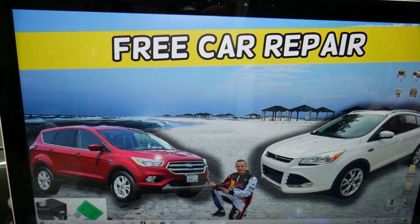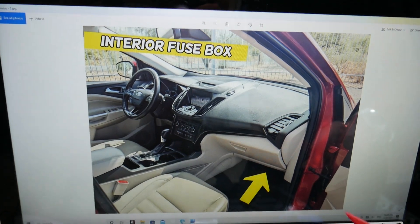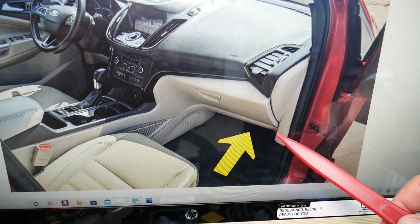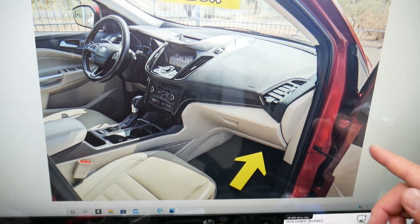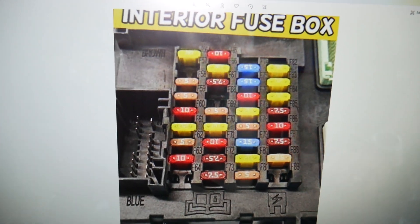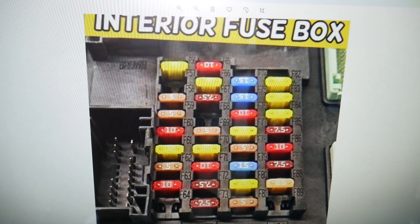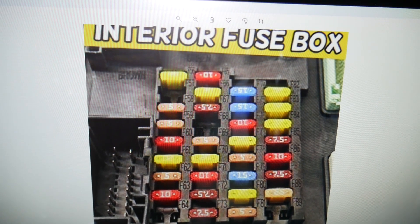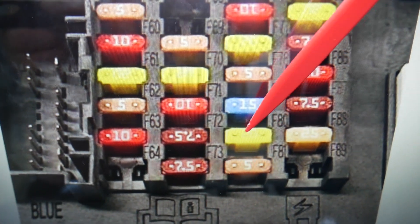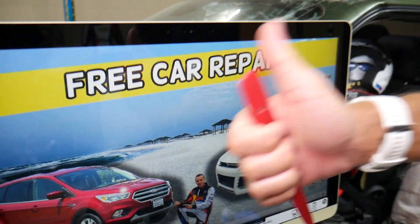Next, you need to open the passenger door. Open the passenger door and once you do that, under the glove box on the bottom, you have one soft carpet panel with two turning fasteners. Remove that liner and you'll find the interior fuse box with a layout like this one here. Here we'll need to check another fuse for the moonroof — fuse number 80. You can see the fuse number is in the top right corner next to the fuse. Hopefully the video will be helpful, thank you for watching, see you guys next time.